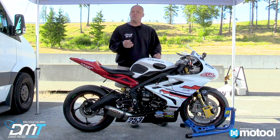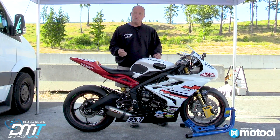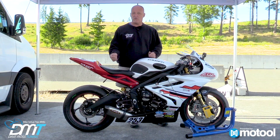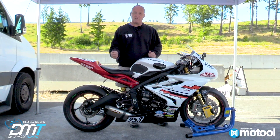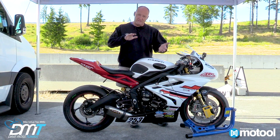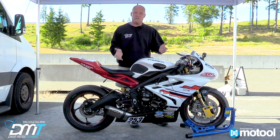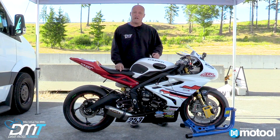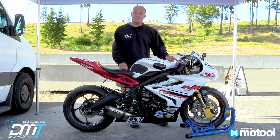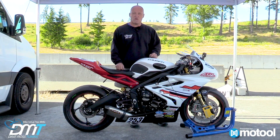If you are sporty and aggressive using your motorcycle, then you would look at 30 to 35 in the front and between 25 to 35 in the rear, because you're cornering. Cornering forces compress suspension more. Depending on your riding style that you've developed over the years based on the way you physically ride the bike, some ride the front harder — so your sag numbers may be small in the front and big in the rear, or reverse, depending on what background you've come from.